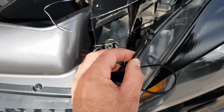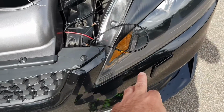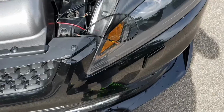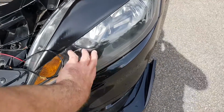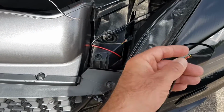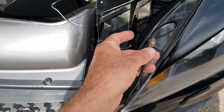Try and find something that has these connectors, which makes your life easier if something blows, if they go, which sometimes they do. They're not expensive at all. You can pick these up between 5 and 10 quid, to give yourself the sort of daylight look underneath your headlights without removing or stripping down your headlights. So having a connector like this, once you've wired it all up, is a good idea, and then you can just reuse the connector. So let's get these wires off and then connect the new ones, and let's see how that looks.